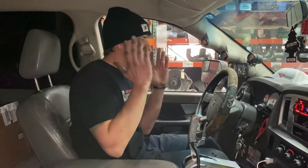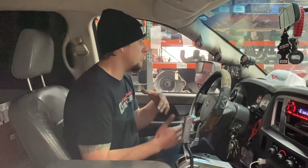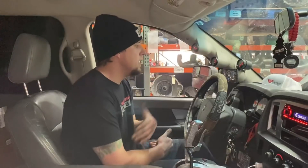I ran it on the same tune and three speed that we maxed out the 467.7 on, so there was a little bit of fuel left on the table. We hit about 42 pounds of boost, so I do think we can go ahead and grab the next tune up. 832 horsepower - we already picked up about 60 horsepower. I think tune 4 will probably end up maxing this out.